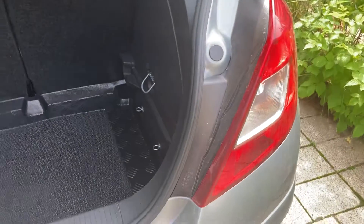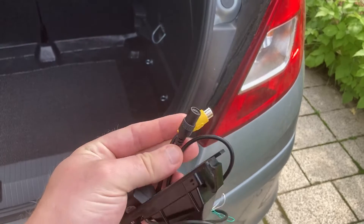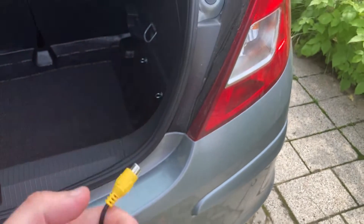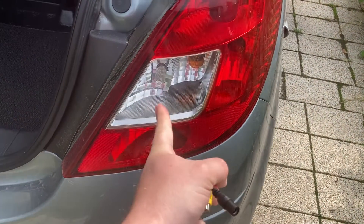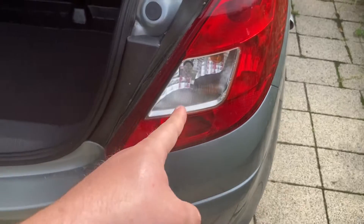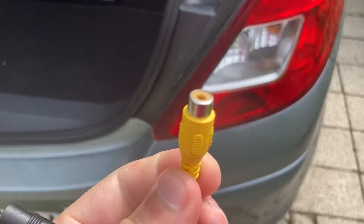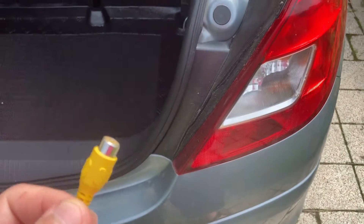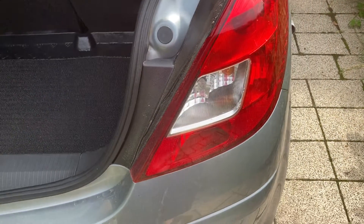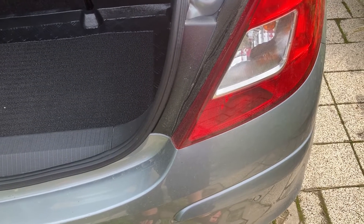The way a reversing camera works: if you look at the back it has two connectors. This one is for power — it needs 12 volts — and what usually happens is the 12 volts are taken from the reversing light, so we have to splice the ground and power wire for the reversing light and then connect a wire to this. The second wire, the yellow one, is for the signal, and this needs to be routed all the way through to the unit. Before we route anything and tear the car apart, we're going to do some very simple connections to the reversing light, make sure the camera has power, power it up, link it to the unit, and make sure it works.